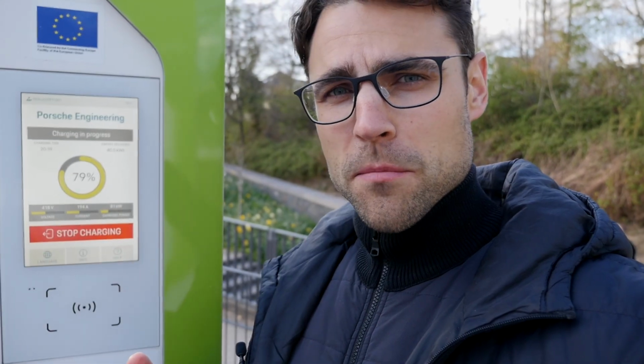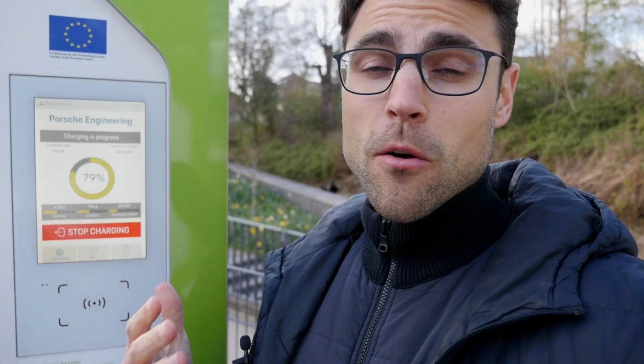Here we go, although we had this charging error in between, just over 30 minutes from 10 to 80% state of charge. And you know, if you combine this one here with the amount we charged before, so around 80 kilowatt hours net into the battery right there, back in these just over 30 minutes. Comparable result to the Mercedes EQS actually. And so actually quite competitive. Again, it needs to be preheated. You need to speed it up on the motorway so that the battery is actually warm enough, or just drive for a long enough time. And indeed, 20 minutes difference is actually when it's cold or at the proper temperature. 20 minutes different, either 30 minutes or 50 minutes charging.